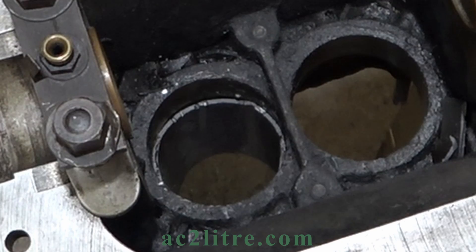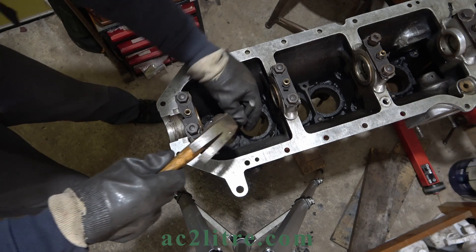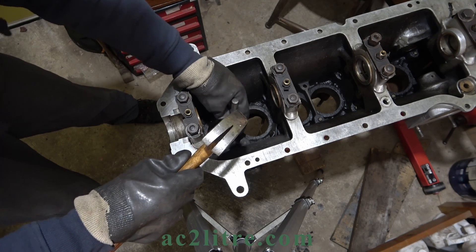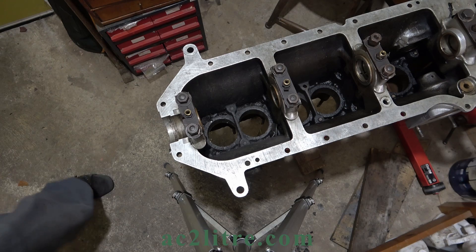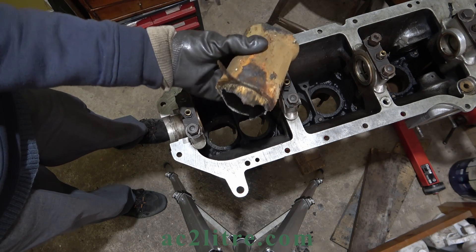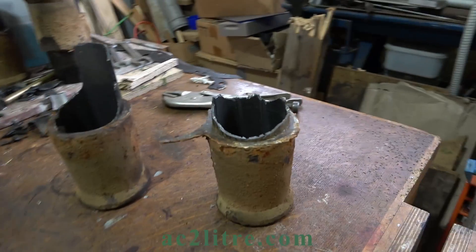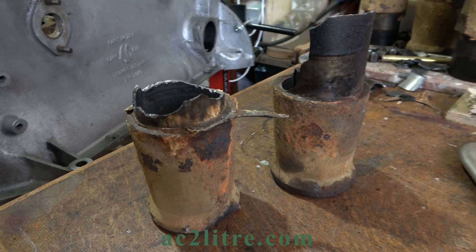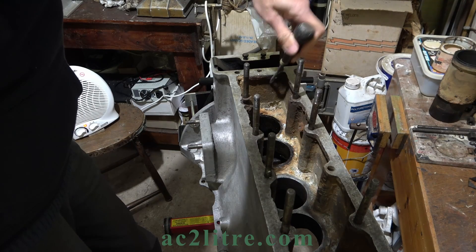100% of the circumference has broken off down to three quarters of the depth of engagement. No movement. Success. You can see the pale brown limescale that had seeped down the bore and presumably helped to stick it firmly in the block. It's handy being able to clean out the water jacket.